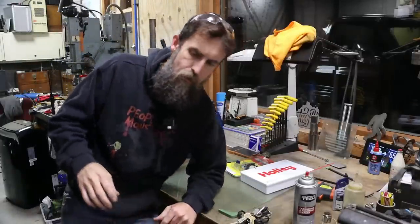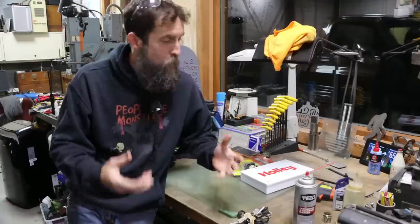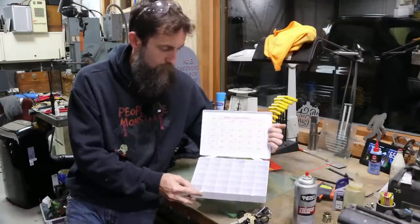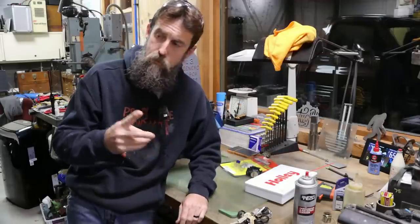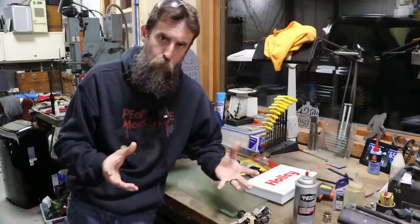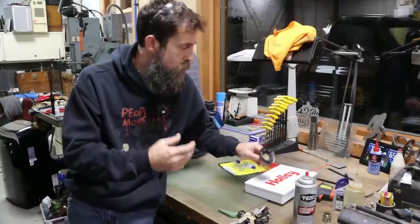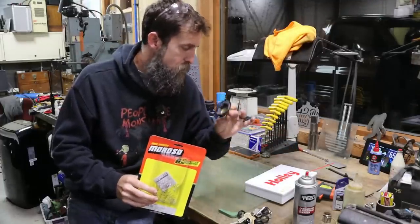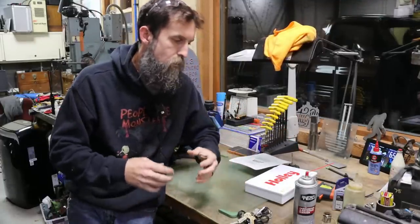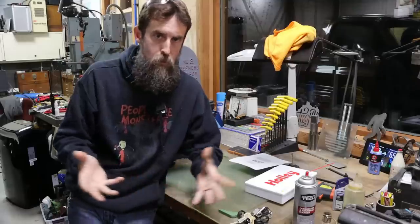This gauge doesn't make fuel adjustments for you — it just gives you the information to make those adjustments on your own. In my case I've got a Holley 4-barrel carburetor with a vacuum secondary. I've got a jet kit, and after driving in all conditions I went up two jet sizes on the primary side and one jet size on the secondary side. I also changed the vacuum secondary diaphragm that operates the two extra venturis under heavy acceleration, and changed the spring that works with that diaphragm to fine-tune the carburetor. I'm really happy with the way the gauge responds now.